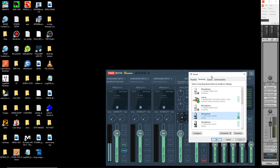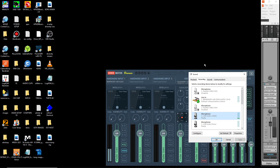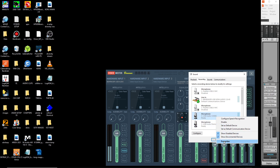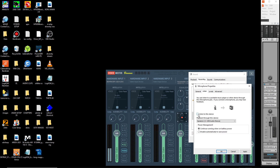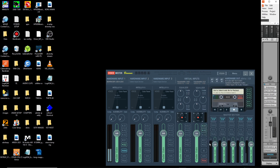One other thing I wanted to mention: if for some reason you light up the system and it doesn't work, go to your speaker icon, right-click, go to Sounds. Go to the Recording tab, find your USB audio codec, right-click Properties, Listen - toggle it off, hit Apply, turn it on, hit Apply. Your audio should come right back on. I had this happen - the computer was sitting here all day, I lit it up and had no audio.